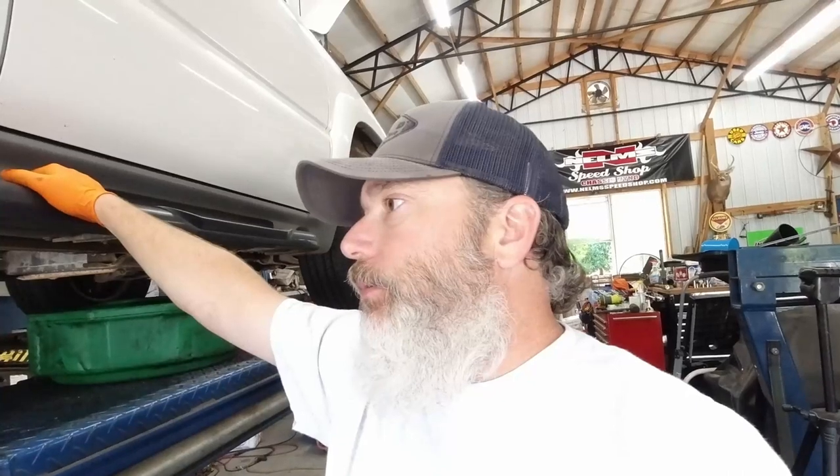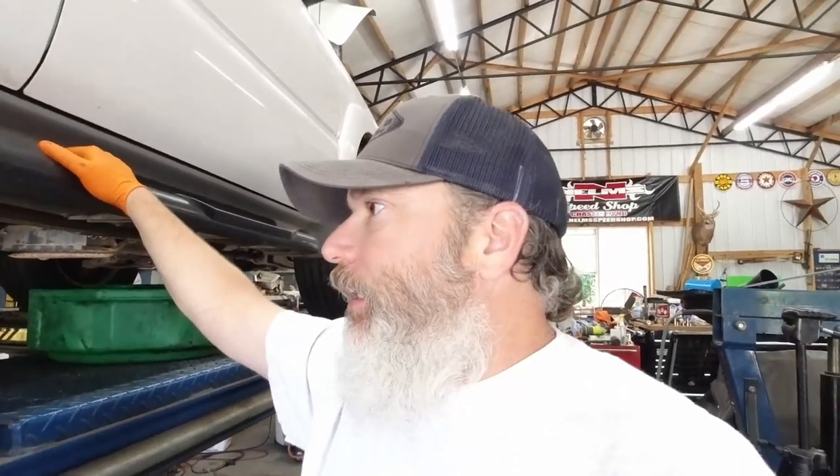If you follow the Suburban story over here, this playlist on the Suburban, there's gonna be plenty more videos too, because we got a lot of stuff to do with this thing. The lifter ticking is gone away for sure with the 0W-30 Mobil 1 in it. So enjoy not listening to the lifter tick when we're riding around. All right, well, I'm gonna change the oil real quick, and then we're gonna ride to the gas station and see if this thing will take gas like a normal vehicle. It should.